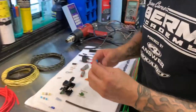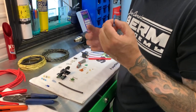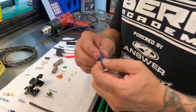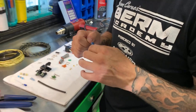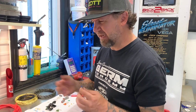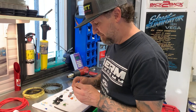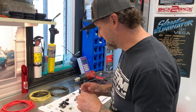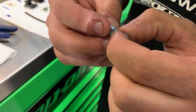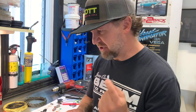This is your standard insulated department store connector. In my opinion, in no way should you ever use one of these. The reason is not that they don't connect okay — it's because you're crimping over the insulation, so you can't test your crimp and you can't get a good crimp. If you need to keep the budget low, at least go to this insulated style with clear plastic so you can visually see your crimp afterwards. They're okay, but I'll show you a better idea.